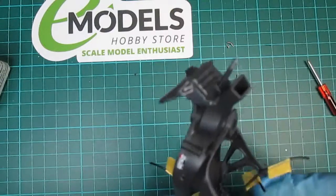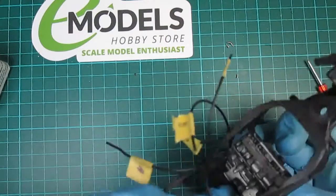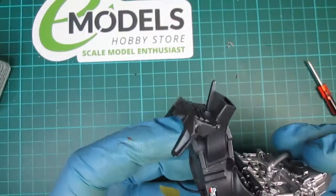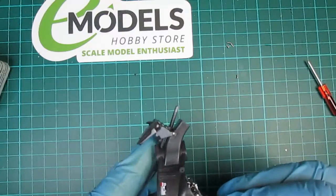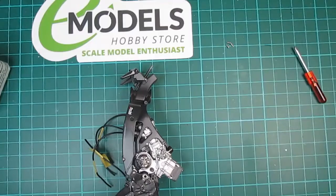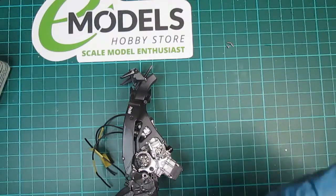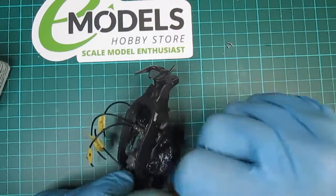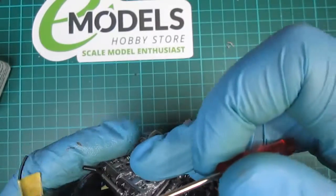Get all these cables sorted out again. So we need the two A's coming through, the B on the outside, taking care not to break the rear brake cable while we're at it. Come along, there we go. Yep. There. Lovely. And again, wet your finger, and then wet the screw head so the screw can catch. Obviously if you've got metallic, magnetic even, screwdrivers, that'll be absolutely ideal.